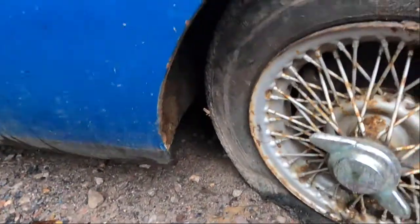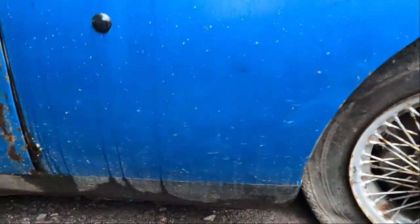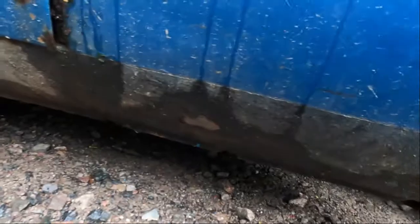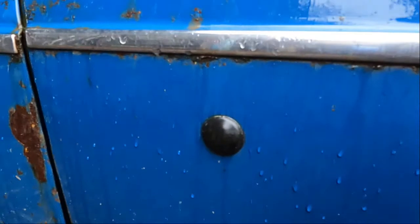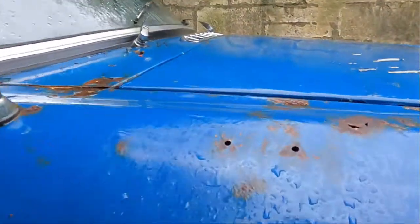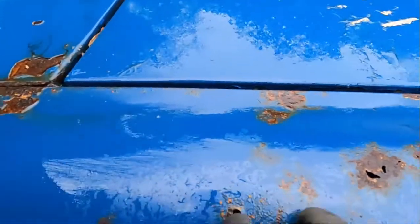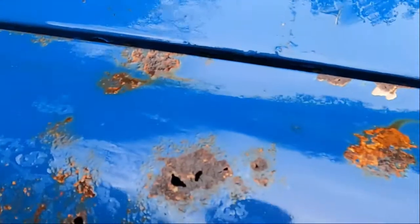This side of the MG we've got a flat tyre straight away which makes things difficult, but the wheel arch looks pretty good to be honest. The bottom of the wing again pretty good — these do rot out because obviously there's a seal behind there, just a bit of flaky paint. Someone has put stone chip on here at some point. Not too sure what the rubber bung is for — probably an aerial or something that's been on the side. Again it's had mirrors fitted, which haven't done too badly actually, but there's some rot at the top where it's been dripping.